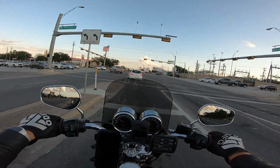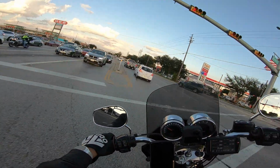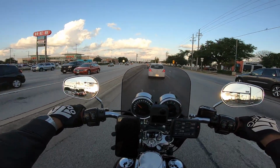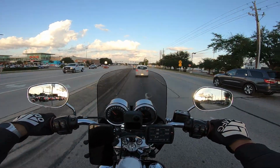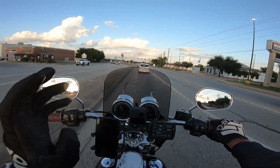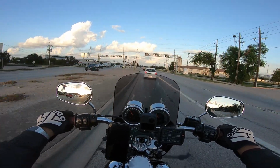And again, that might also be attributed to us needing to flush our rear brake system. We have yet to do that, and we are at 38,000 miles. I believe that's a 20,000 mile service that you do that. We've done the master cylinder on the bars tons of times because we're always swapping brake lines, we're always doing all kinds of stuff and swapping calipers.